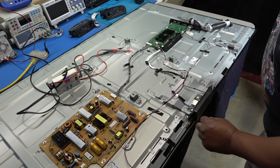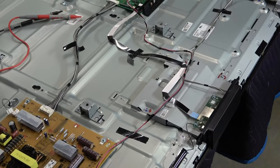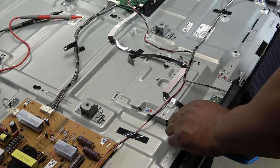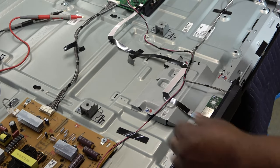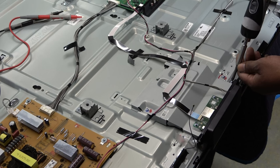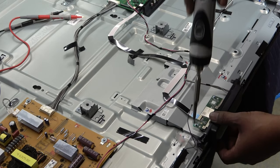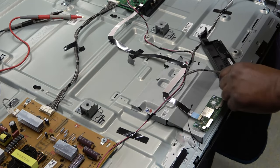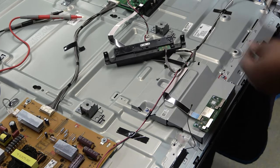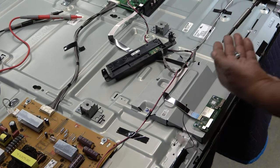And it looks like we got a Wi-Fi module with the antenna right here. Okay. We're just gonna take the antenna off. Just turn it around until we get to that sweet spot. Comes right off, okay. This needs to come off, evidently. Our little pad with our light, and also the infrared detector is in there for the remote control. And then we're going to pull this bottom bracket off. This also has to come off, looks like.